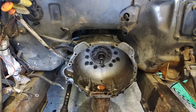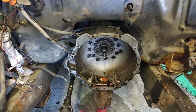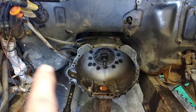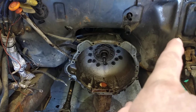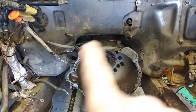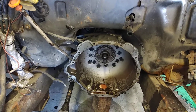I have a lot more time now. So that's my next project — to get this one, get the transmission out. Later I'll be taking out the propeller shafts, front and back. There's a big cross member underneath which I'll be unbolting. It's a big unit, this transmission. I'm going to be supporting this part with my engine hoist, and then on the back I'll put a couple of jacks underneath and lower it to the ground and just get it on the floor.